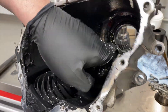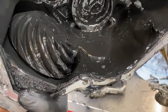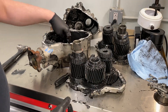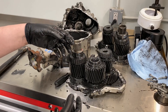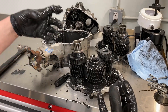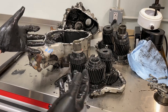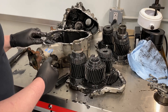These bearings feel fine, but the idler is all chewed up — my hand is getting cut by it. These can fail all kinds of ways, but the idler and its bushings in the case are what fail first, then the bearings, then the teeth after that. It's all because of the fluid breaking down. Without the protection, it's just metal against metal eating away. These units are around $900, plus labor — each one I do runs between $1,200 and $1,400 to drop in a new unit.